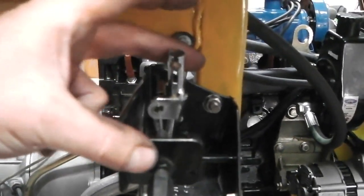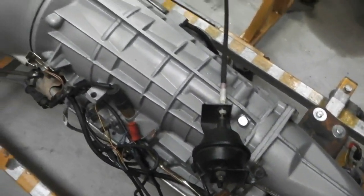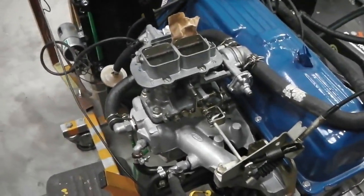I don't know how much the Pinto needs. I would have thought there wouldn't be much difference between this and the Granada, but they might have used levers. I've gone virtually direct. I'm not getting much leverage force here at all, so I'm losing a bit. But the range of the bellows isn't far off. From fully open to fully closed, you get the full rev range, so we're going to have to see how that works. We need to get the vac pump. I think I've left that in the car at the paint shop. So if I was to connect the vac pump up to this and just run it a little bit, I can just see if indeed those bellows are able to pull that throttle open there like that. We're going to test that in the next few minutes. Let's see what we can do, and then we'll go and spy on the body shell.